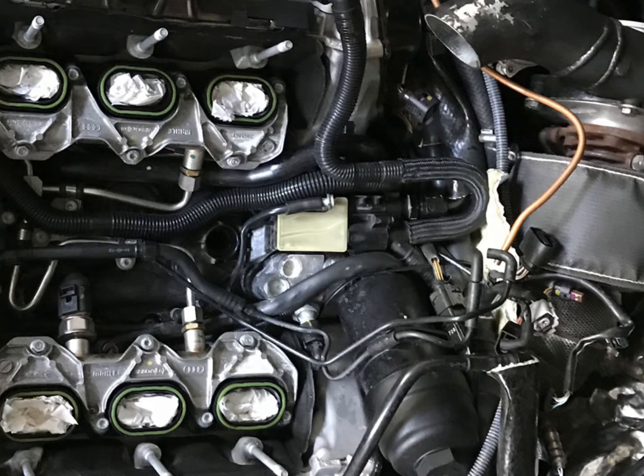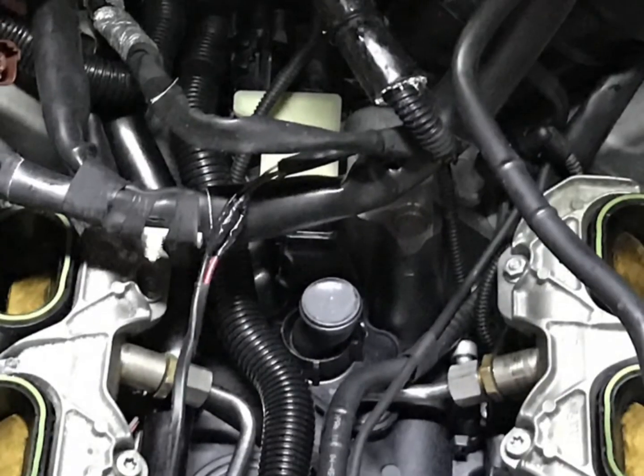In your case, you probably don't have to do that insulation. The PCV inlet, as you can see, is filled with JB Weld, which blocks the flow to the supercharger.